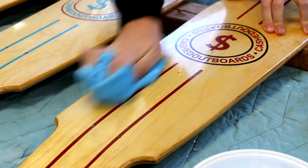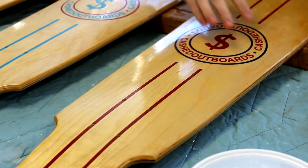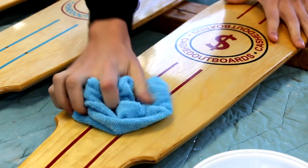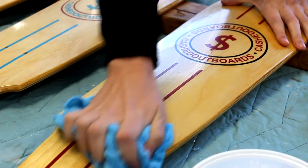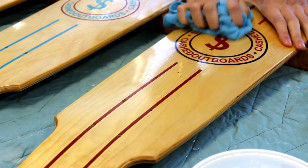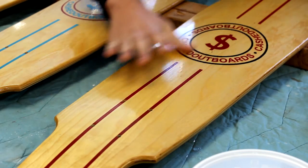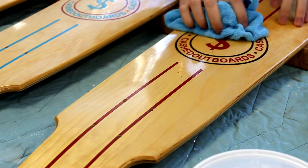If the surface isn't very smooth and the clear coat isn't thick, don't push for a perfectly uniform haze because you'll end up burning through the clear coat. On mine it's pretty smooth — you can still see some streaks that are shiny, which are the low spots, but with the clear coat job I'm doing it'll come out fine. So now you can move on to the next step, which is finer sandpaper.